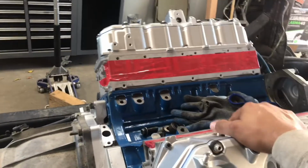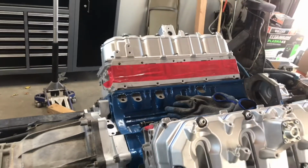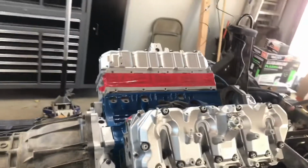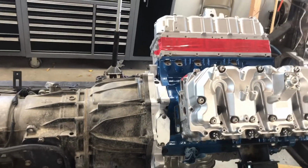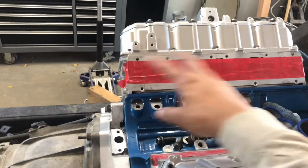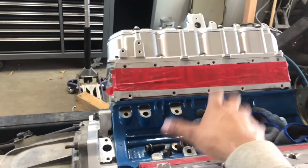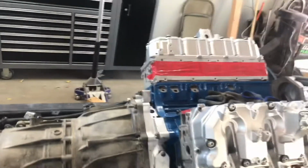And then all I gotta do is put the rest of the stuff, like the intake plenum, the turbo, and CP3 pump and all that stuff. But I'm not gonna put that in right now, because if I need to move the motor over a little bit or pick it up a little with a cherry picker, the intake plenum will get in the way when I go to put the chains on, and I don't want to risk damaging it. So I'm gonna leave that for right now.